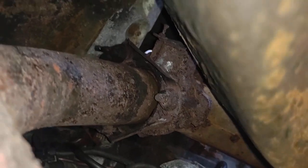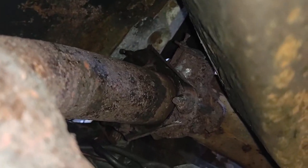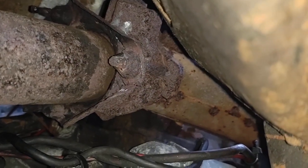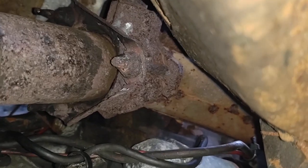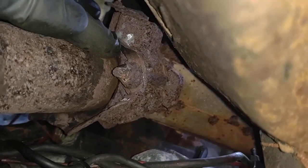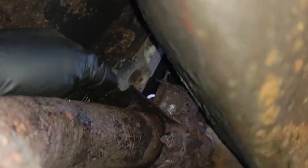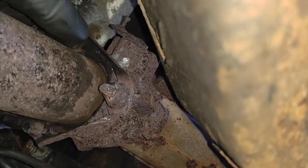This is your flange — it's no good. That's where all the exhaust is coming from. The flange is rotted, the bolts are rotted, and the whole exhaust manifold has to come out for this to happen. Unfortunately this flange is no good, so unless I can find what they call a quickie flange, which doesn't allow room to put it in, this side is bad as well.